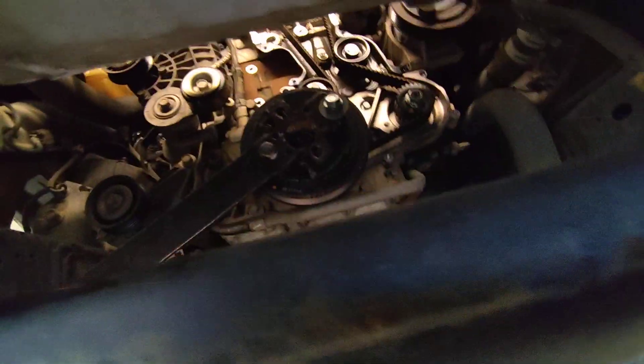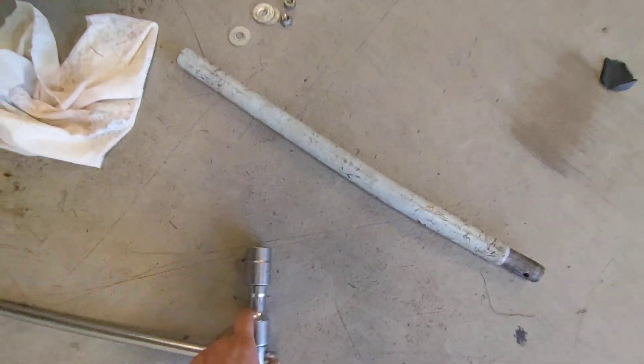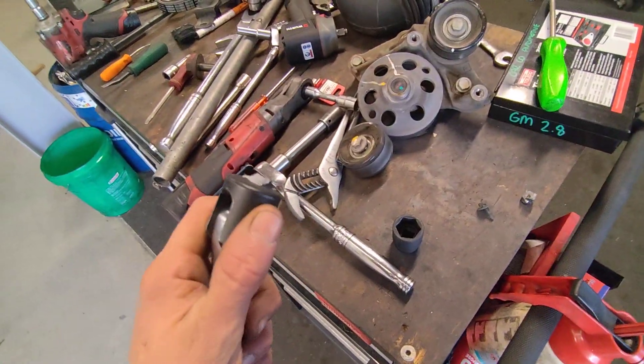You'll need something to lock the crank off — something decent. Don't lock it off on the flywheel or anything like that, you'll break something. I used a two-meter long bar and you'll just snap half-inch drive power bars off — it's too tight.